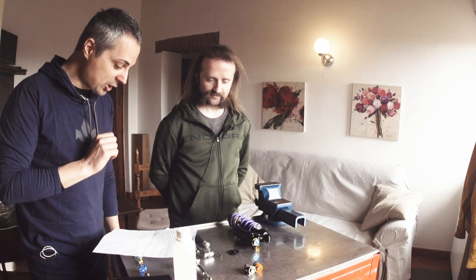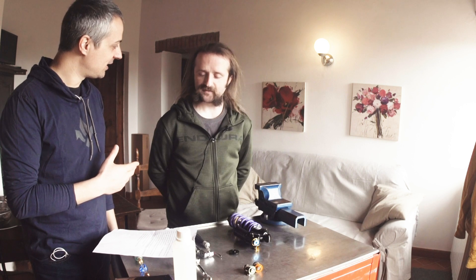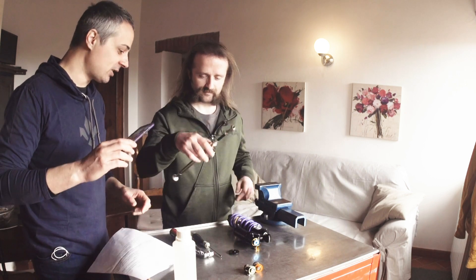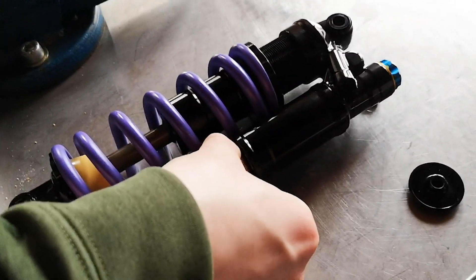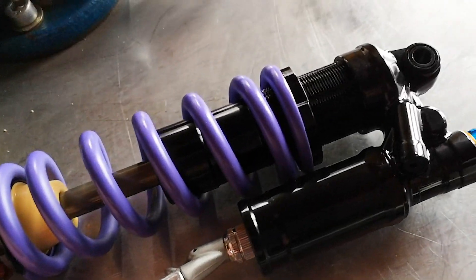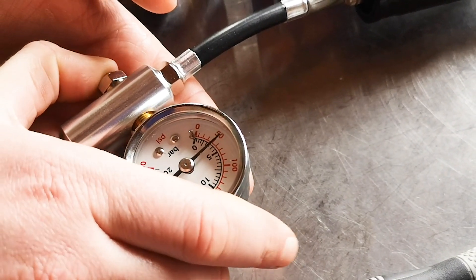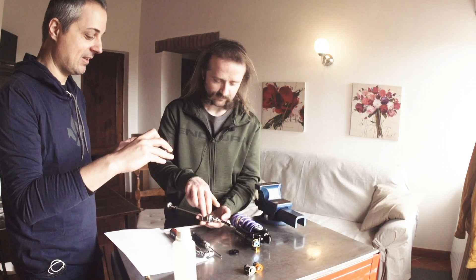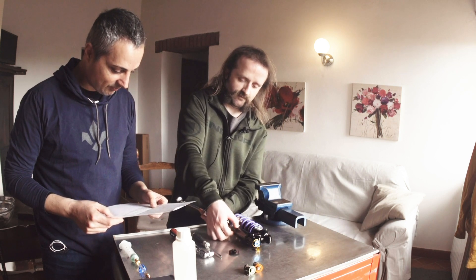So, remove the pressure from the reservoir using the formula pump. Sorry, I have such a bad pronunciation for 'reservoir.' This is a very sensitive step because if you do not remove all the air, we'll do an oil shower. Our pump has a quick release. Be sure that all air is out. Here we go. Perfect.